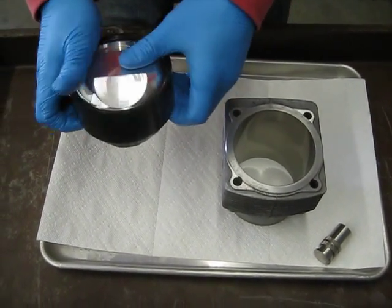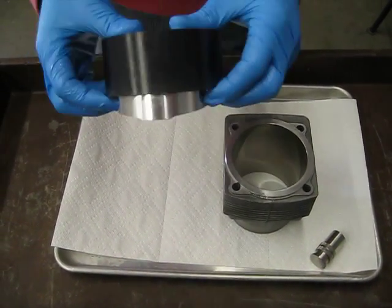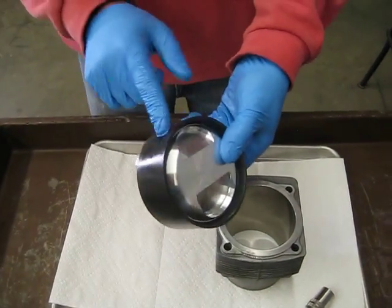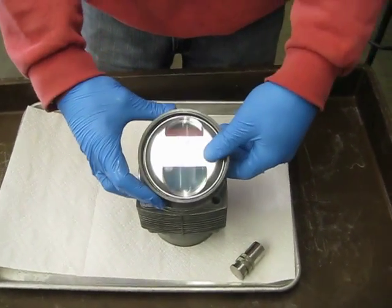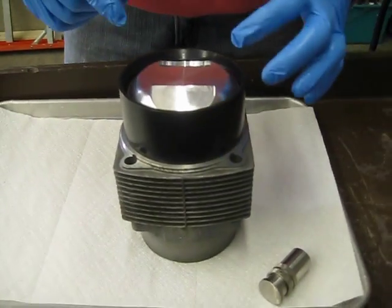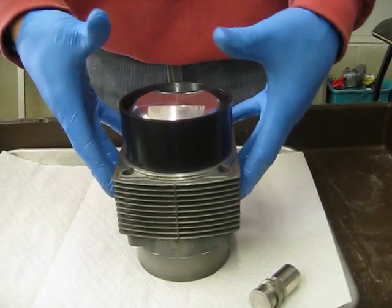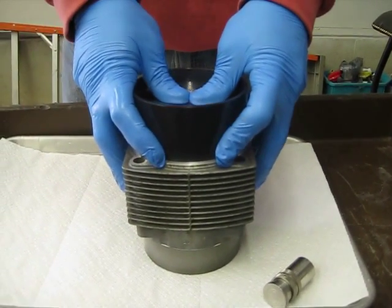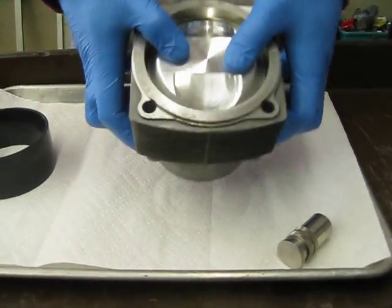You can see I've got the piston inserted into the sleeve. I'm going to insert it enough to leave a little bit of the piston sleeve extended below the ring compressor. I'm going to go ahead and insert this into the cylinder now. I set it in place with my valve pockets oriented how I want them, and I just go ahead and push down from the top of the piston gently as it goes in. I can feel the piston rings slip past. That's it — the piston's installed.